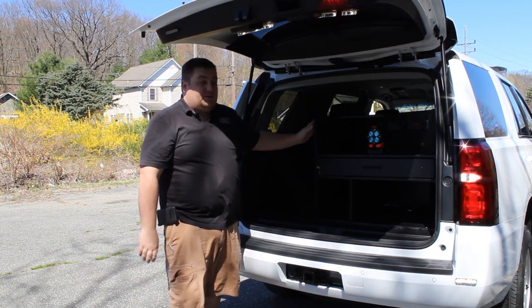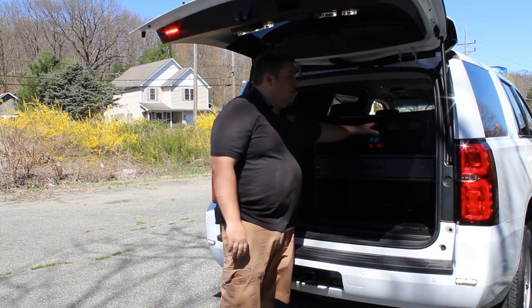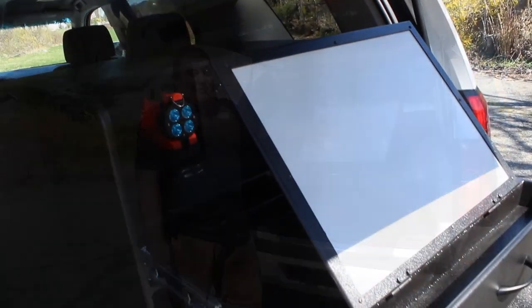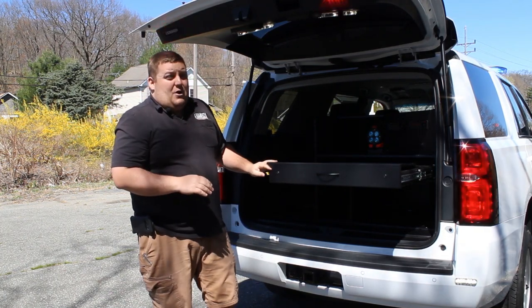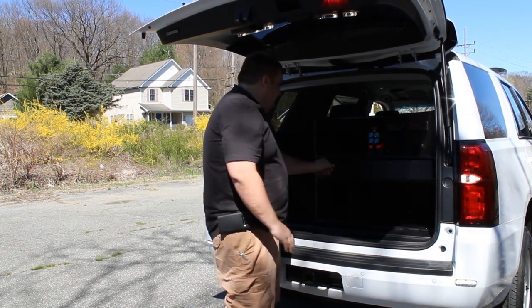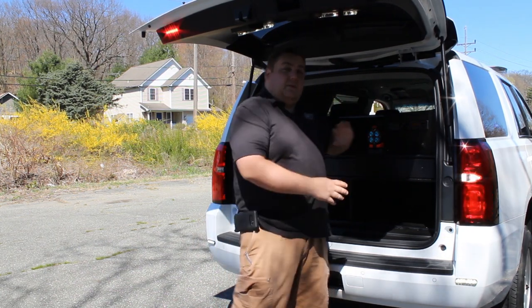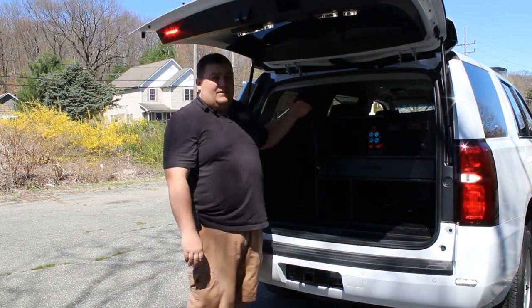Looking at the cabinet, there's a custom design cabinet that we built for the customer, finished in our sprayed-on tough coat. It has a radio face plate, we've mounted their flashlight charger, and we've given them power ports such as 12-volt and USB. We have a command board that ratchets into multiple positions — this is a magnetic ratcheting command board — and we also have a pen storage area. The drawer features the Accuride 9308 600-pound lock-in lock-out drawer slide so the drawer won't go in until you release the latch. We also have a large open cubby for an extinguisher, another large open cubby for medical bags, a pass-through that allows a set of irons to be mounted through it, a large gear storage area, and additional storage on the back side.